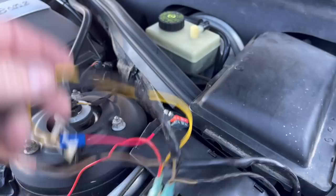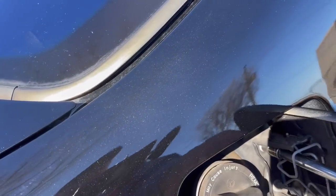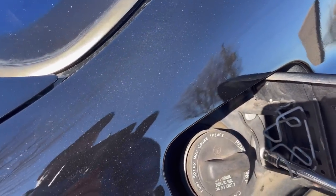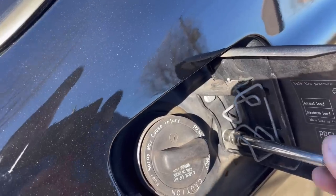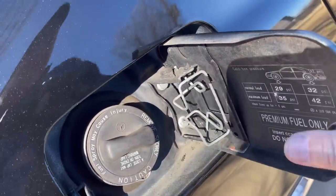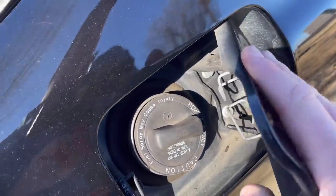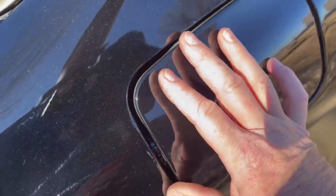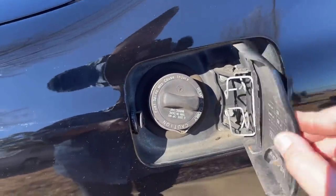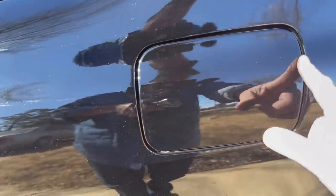This just does not cut it for me. All you got to do is get a 10 millimeter, put it right in here, loosen these things up a little bit, and then scoot it back. Then we can bend this tab to where it's supposed to be — scoot you back a little more. Super easy fix. Tighten the bolts, get the little latch to go in here, and — voila. Look at that. Perfectly in the middle. Love it.